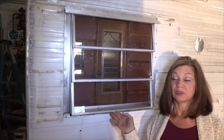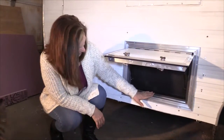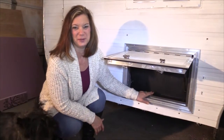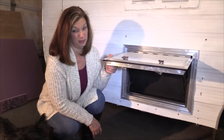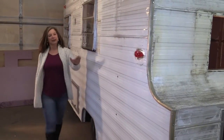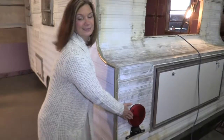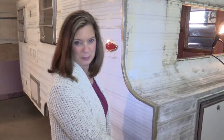We've got most of the windows rebuilt with all new seals. We got some new hatch covers — this is where we'll plug in the electric and fill the water tank — and these are clearly much more durable than the original ones. We've replaced all the running lights and the wiring that goes with them. We took all this corner molding off, re-caulked and resealed, and stuck it back on.